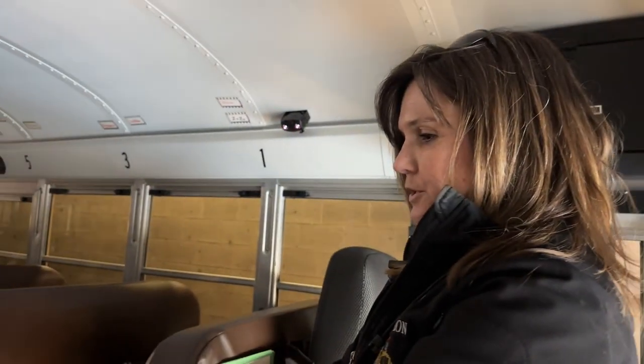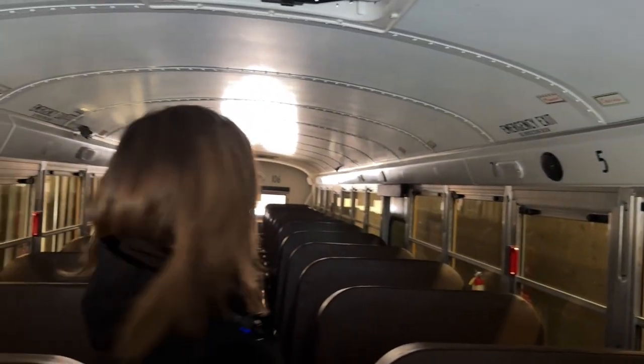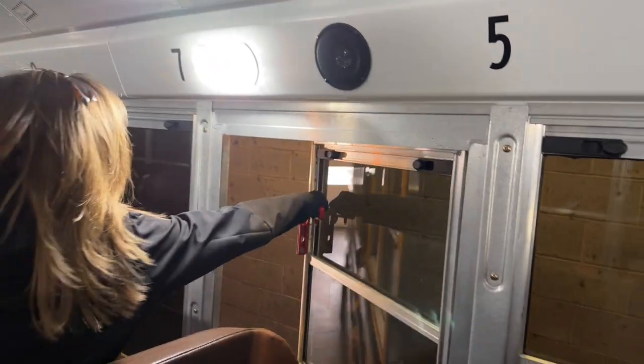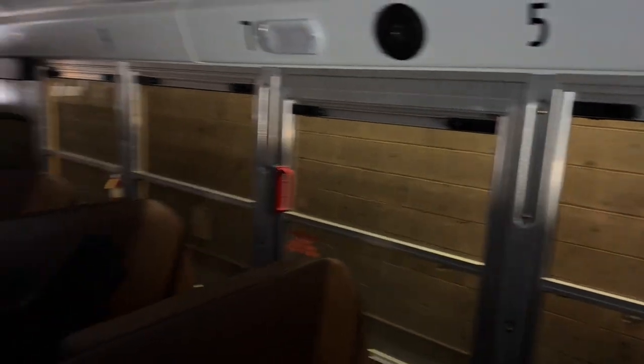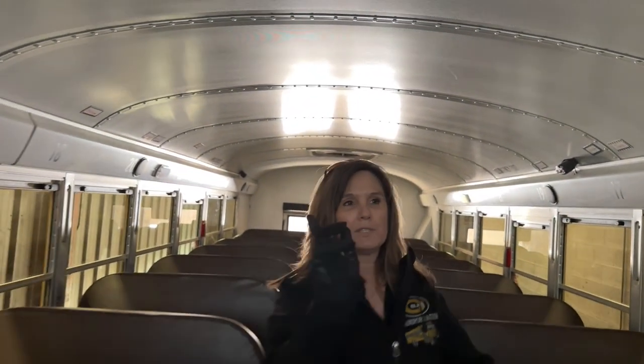All of our seats are bolted and mounted securely. The frames are bolted securely to the floor, and the seats are attached securely to the frames. We'll lift up on each of those going back — not cracked or broken, loose or missing. We'll stop at this window and open it — emergency window. Lights come on, buzzer sounds, opens freely. When I close it, it all goes off. We'll check our emergency door — lights come on, buzzer sounds, opens easily. When I close it, it all goes off. I would check all the other windows the same way.